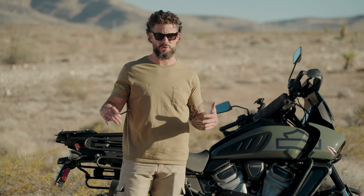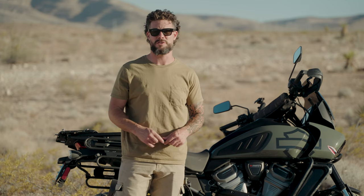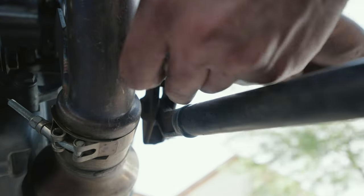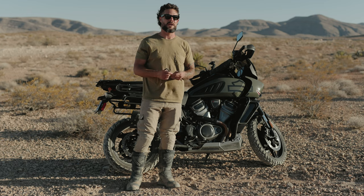Let's get into the tools you're going to need before you get started. First of all, you're going to need either a T40 wrench or socket. You're also going to need a six millimeter allen key — I highly suggest getting one with the ball-end socket; it makes a big difference because when you get under there and you're trying to get those last couple screws out of the center stand it's really hard.